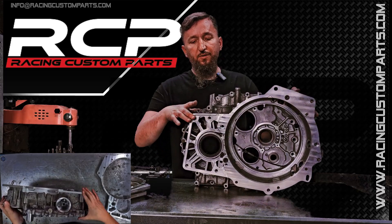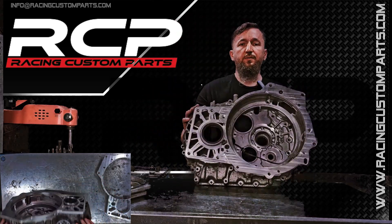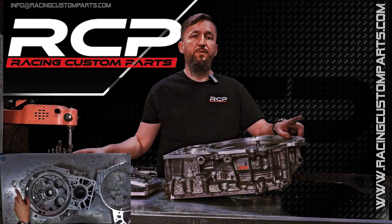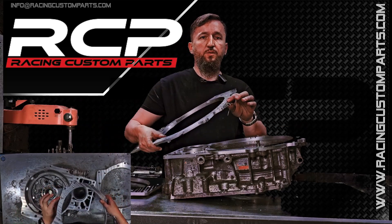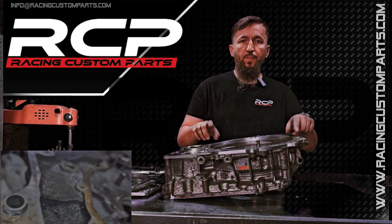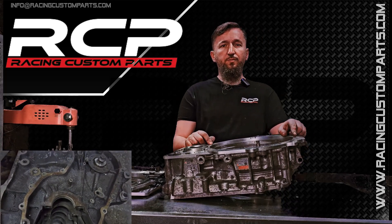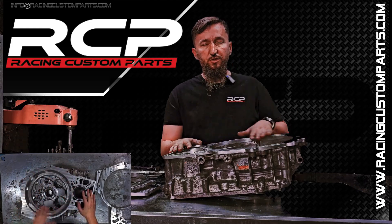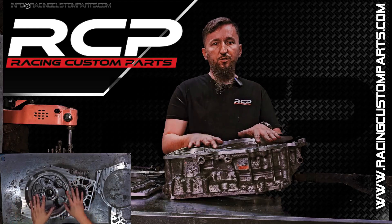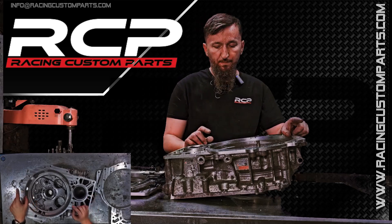In this area, the adapter might stick out a little due to stress, but the adapter will be bolted down after installing the transfer case, so this will be another element holding the adapter in place. One more very important thing: you always receive adapters or transmissions with a sticker saying 'dowels max 5 mm.' It's about the two dowels in the R32 engine block for centering the transmission. You need to shorten them — they must be a maximum of 5 mm in height. This is very important because if you leave them as they are from the factory, which is about 6–7 mm, the adapter won't sit properly and the transmission will be mounted crooked. If it's mounted crooked, you will damage the clutch, the flywheel, and possibly even the transmission — remember, the dowels must be shortened.